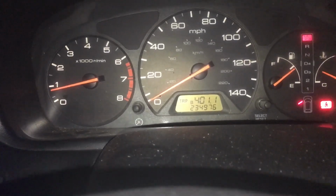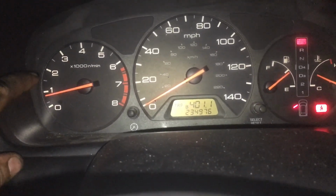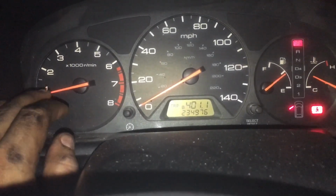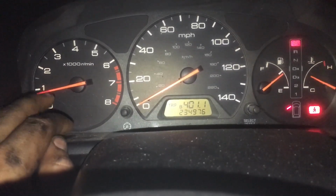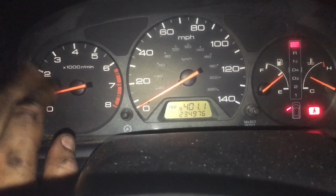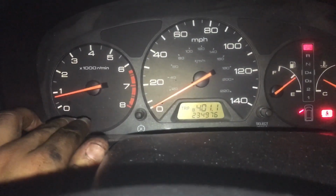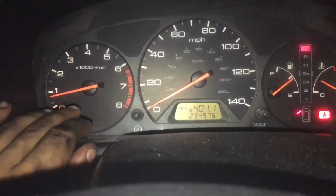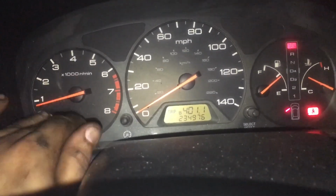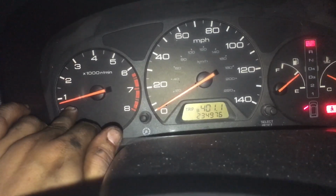You can hear that and see from the tachometer it's bouncing up and down a little bit, starting to idle out. And for me, I know I had a bad spark coil because I just did the spark plugs and I was getting a random misfire code, which in this type of vehicle that has coil-on-plug like that, is normally caused by those coils or the spark plugs going bad. These are brand new spark plugs. I thought it might have been my spark plugs. It's not that, so it's probably those coils. I'm waiting to see. As you can see, I have no check engine light right now. I cleared that to see if the check engine light comes back on. I have a smart OBD reader, so I get notified on my phone when codes do pop up on the vehicle, and you can actually see it's starting to lower a little bit more.